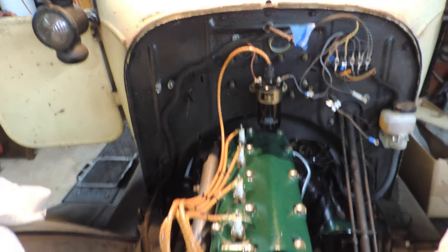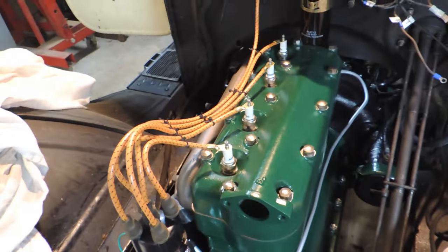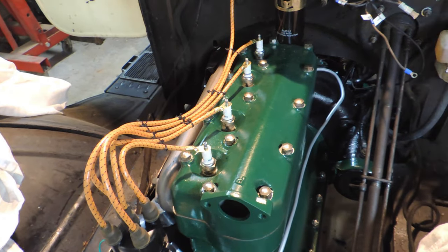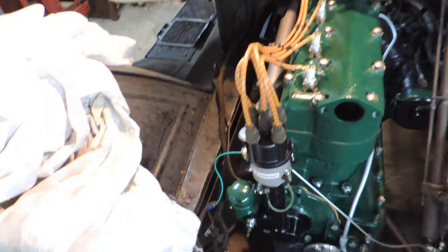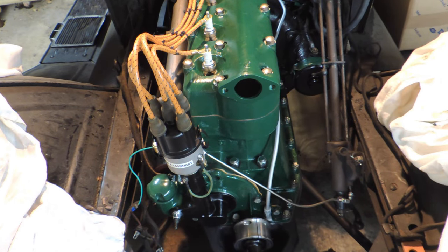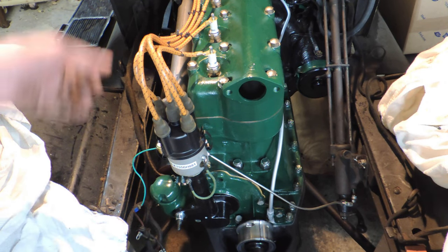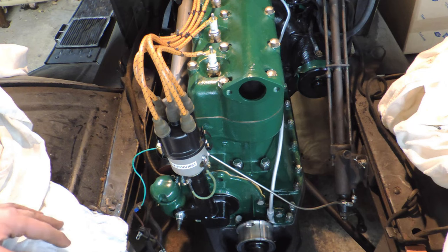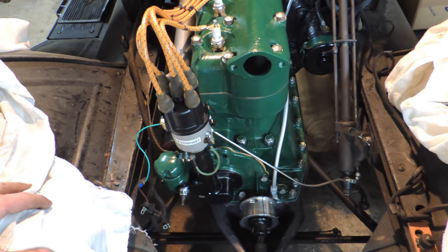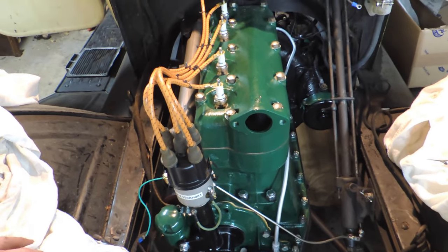Okay, here's our final product. You like my zip ties? Look how neat that is. The reason it's looped up is this has to turn. Ignition is in, we are done. I'm going to put a little heat shrink boot over that so it doesn't bump the frame, and we're going to call it today. The next video will be — I'm probably firing it up. I've got to hook up some fuel line, the exhaust is hooked up. I've got to do a spark rod, a throttle rod, a little bit of electrical. Then maybe we can hear it run. I'm thinking we're there. I'm going to leave the fan off for safety reasons until I hear it run and make sure there's no problems. Thank you. Stay tuned. We'll see you in the next one.